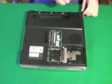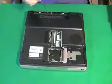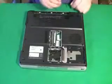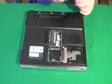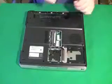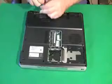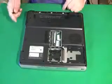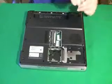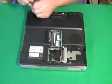And the way to get that off is usually to just pry it off, unless it's held in by screws, and that's why I turn the computer over. I'm going to remove any screw that appears like it's directly under the hinge cover plate that could be fastening it on, because I've pried that hinge cover plate off in the past and sometimes it's screwed in from the bottom and it breaks. So rule number one, if you have to force anything off of these laptops, stop what you're doing. It's probably going to break. So I just play it safe and remove all the screws that could possibly be holding that hinge cover plate on. And the only way I'll be able to tell is when I go to attempt to take the hinge cover plate off.